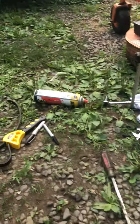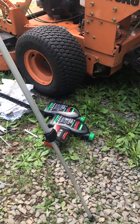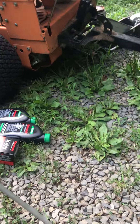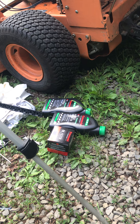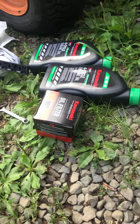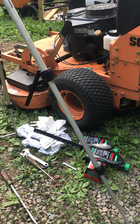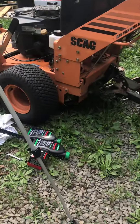I'll show you how I got the bolt cracked — thank god. You're going to need a pan to catch the oil, two quarts of four-cycle 10W-40 — they used to recommend 10W-30, but now it's 10W-40 — and obviously your oil filter. Definitely go to a dealership to get the oil. Let me put you guys on the tripod so I can show you.